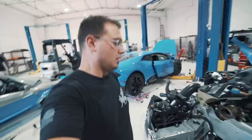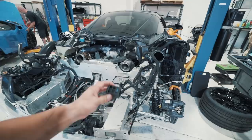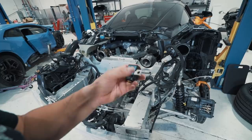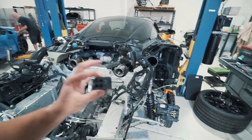I've got all the stuff done. I've changed the inertia switch, which is pretty cool. I don't know what they're called anymore, but back in the day when the car gets into a collision — whether it's rear-ended or flips over — this little thing here sparks and creates like a little bomb, and it cuts this fuse right down the middle. That's the main power to the car, so you don't have to worry about the car catching fire from the electrical system if you get into an accident. It could still catch fire from the fuel or many other ways, but this prevents a lot of deadly situations.